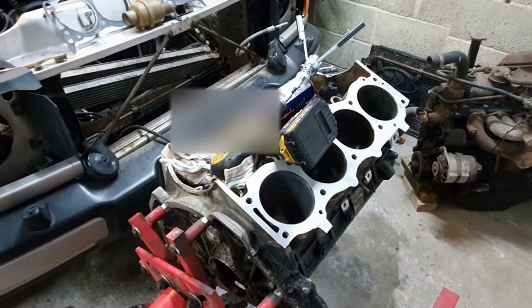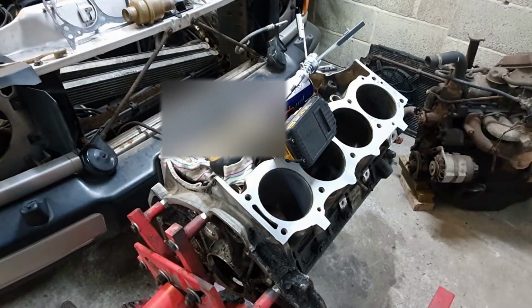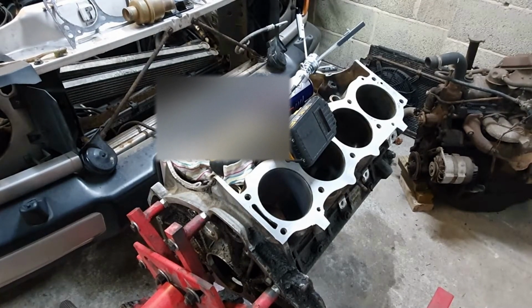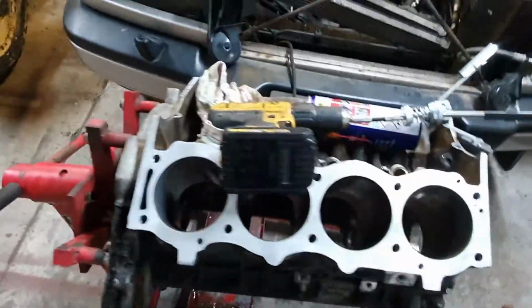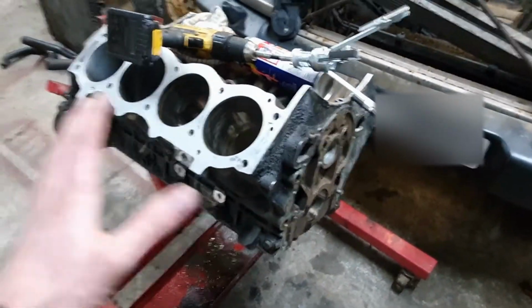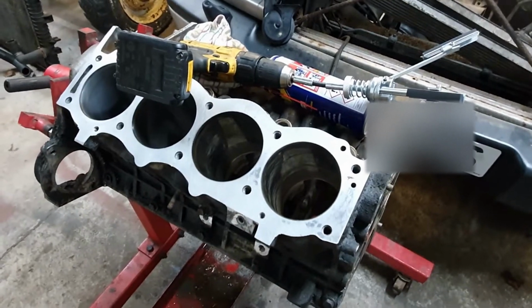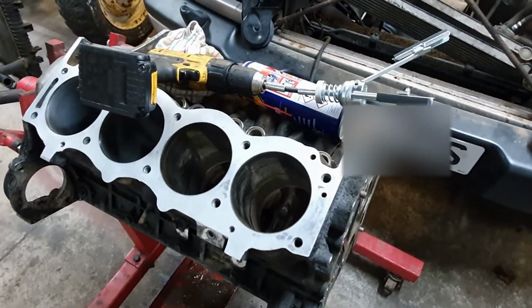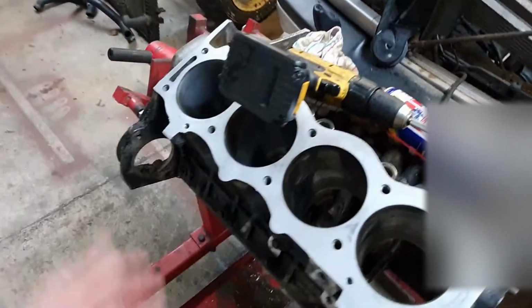I've been sanding that with a thick steel plate and measuring the clearances with feeler gauges on a straight edge, and I kind of ran out, and I wasn't happy with the straight edge, so I bought a better one. I haven't continued the job yet, but I'm fairly happy with it. I've checked it with the new straight edge now, £120 worth of 600mm straight edge, and it's looking pretty good actually. There's a little bit more work to do, but for now I'm onto honing.